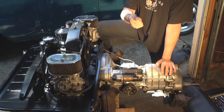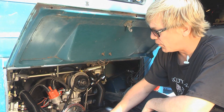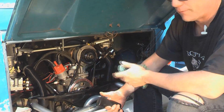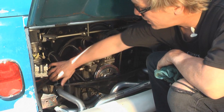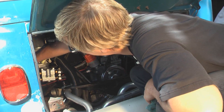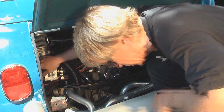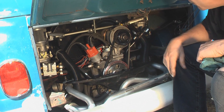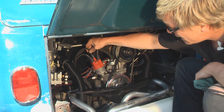You've got to have your key in the accessory or on position to get power to the battery. We got the motor cranked for about 30 seconds — it looks like we have oil pressure in there. I checked the oil lines, everything looks solid, not leaking. The clear fuel filter — I see fuel in there, looks like we're getting fuel pressure to the carburetors. Everything looks good. I didn't hear any knocking or anything, so I think we're about ready to fire it up. To do that we've got to put the coil wire back on.